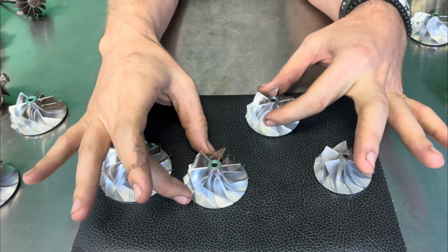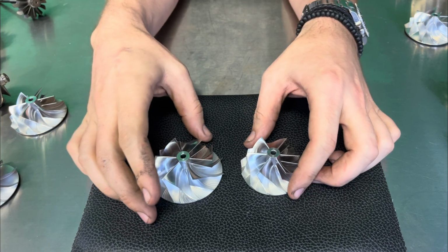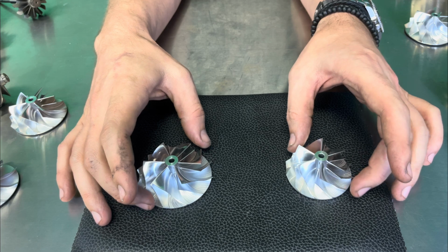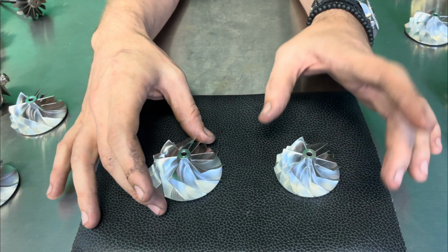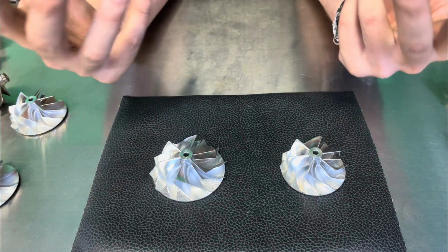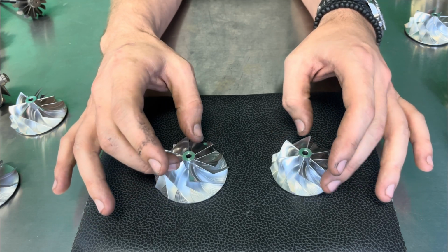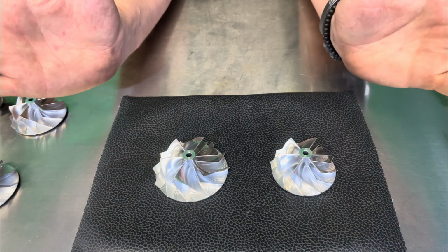Next, moving forward, if you get rid of the 14T wheel here, and we're just solely talking about the 19, we're gonna get rid of the 16 wheel as well, the 19 versus the 20G wheel. Now, between the 19 to the 20G wheel, these are going to range anywhere between making 360 horsepower all the way to 450. Now, a lot of people are going to scoff, make comments, there's no way you're making 450 on a TD04 HL. Well, that's not true. Depending on the displacement of the motor, there are other applications out there, maybe not so much in the Saab world. Now, we have personally seen, there is a Volvo customer who is making 480 brake horsepower on a 20G turbo setup, which is just unheard of.